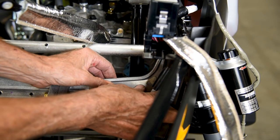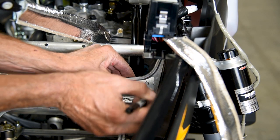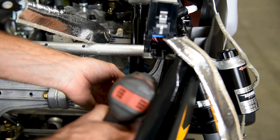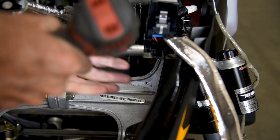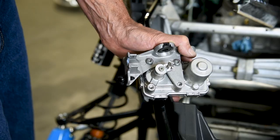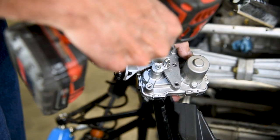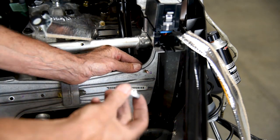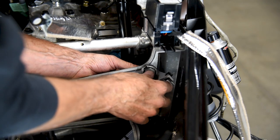Using the provided stainless steel template as shown, mark the hole on the bulkhead for relocating the exhaust valve servo. Drill the hole using a 1/4 inch drill bit. Remove the servo motor from the servo mounting bracket. Install the provided beveled spacer with the beveled edge toward the bulkhead between the mounting bracket and the bulkhead using the provided 6x1x20mm flanged bolt coming from the engine side.